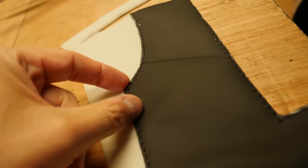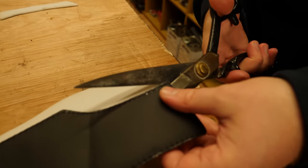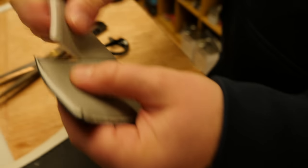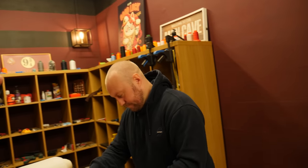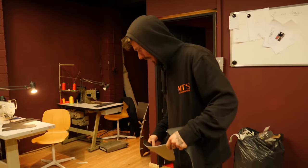You might think why are we filming putting the leathers on the car — but this is actually quite educational. Why are there little slits in the leathers? Those are notches to help line up the panels so you know they're bang on. And with these bits you've got to keep the scissors on an angle — because you don't want excess over the edge. You're cutting at an angle so when you sew it and cut it, you can see it's angled in there. It's like a jigsaw puzzle.